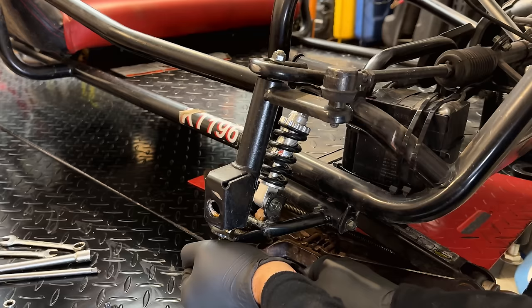In case you're wondering, this is a Briggs engine on this Generac frame. I've been using this as a test stand, and this was the machine that Ken gave to the channel. It actually belonged to one of his customers. I ended up using it as a parts machine, and as a result, I saved two other Generac GP7500s. Jason's needed a new engine, Brendan's needed a new power head, and the engine that's on here right now was Eric's engine that had blown due to a lack of oil. He opted to repower with a Subaru, but this engine was very rebuildable, so I did rebuild it, and it runs well. So this generator has served a few purposes, saved a few machines, and hopefully it's going to get the electric start to work on the go-kart.